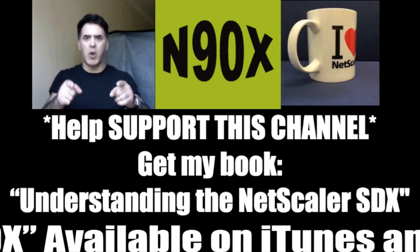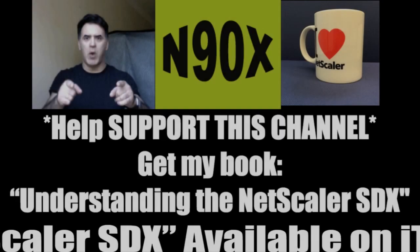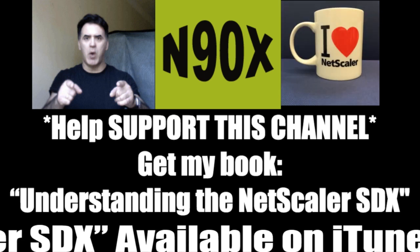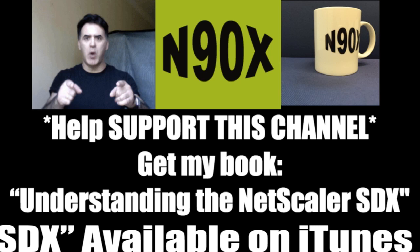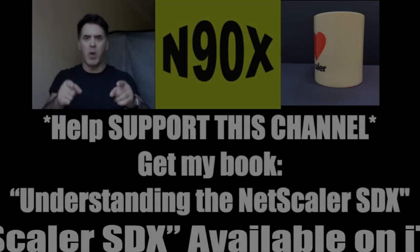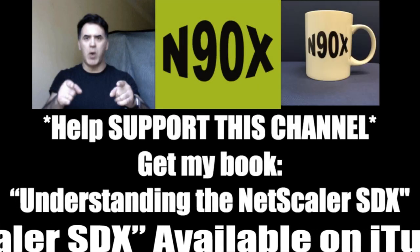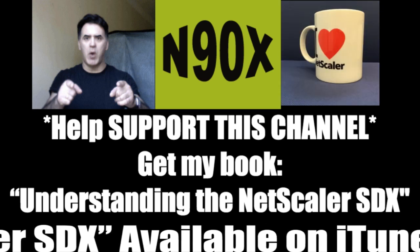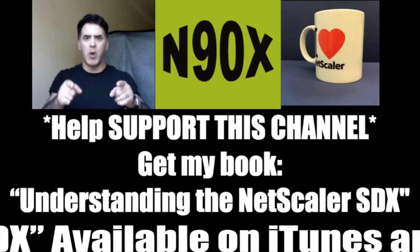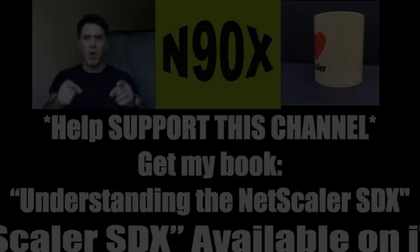Number two, if you put in Chelsio network cards into the NetScaler and try to boot up, the system will crash because there are no drivers for it. Now, certainly you might be able to go in, add the drivers for it. It is FreeBSD, but of course if you were to upgrade, you'd lose that. But even using the identical Intel 10 gig dual port network cards that the NetScaler supports, they still were not showing up in the NetScaler GUI or even in the command line. So I did try that, and maybe you have a way to get around it.